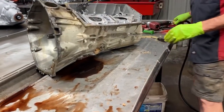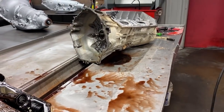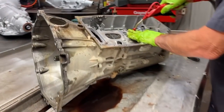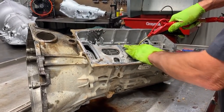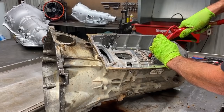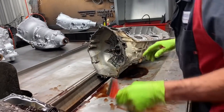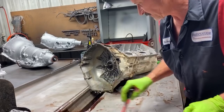I'm going to try to air check a little bit of this real quick and see what happens — I'm not going to get oil off, I'm just going to listen for some leaks and stuff. That's a lube. Looks good there. You can hear some leaks across a couple of these channels through here — that could be just because of hard pistons, shrinkage of the pistons, because these got all bonded pistons in them, and then they actually got individual seals too.